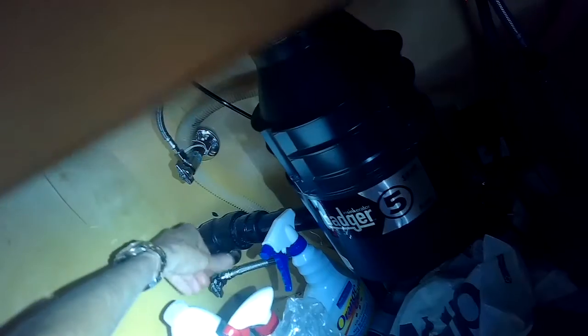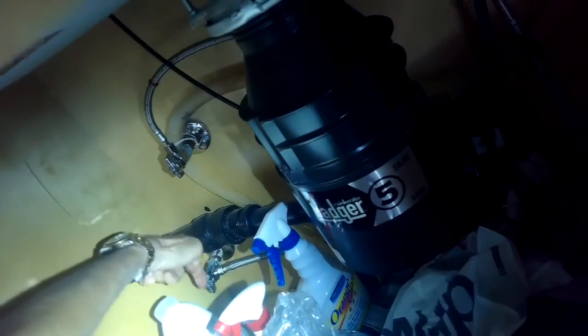Usually underneath your sink there will be a hose that's going to the dishwasher, and there's usually a valve there. Sometimes you have to turn it all the way to the right. In this case it's a valve you just turn 90 degrees. I'm going to turn it to the right 90 degrees so that it's stopping the water flow from going to the dishwasher, pointing down. And then all I need to do next is remove a plate below the door.